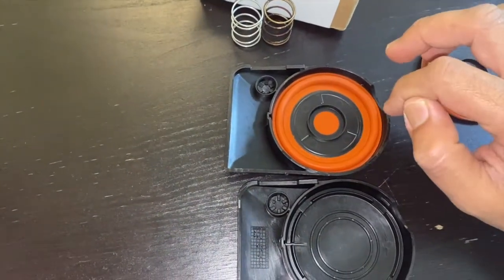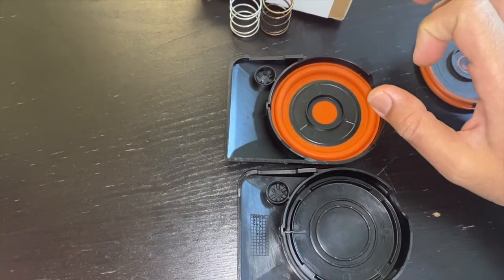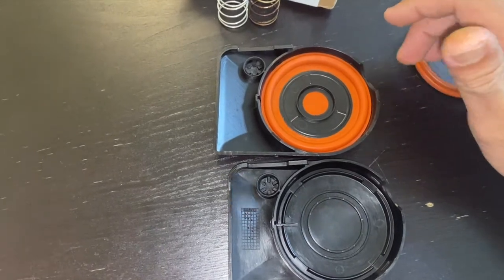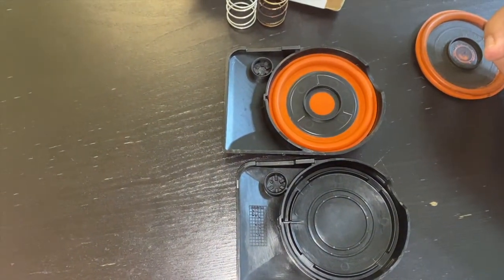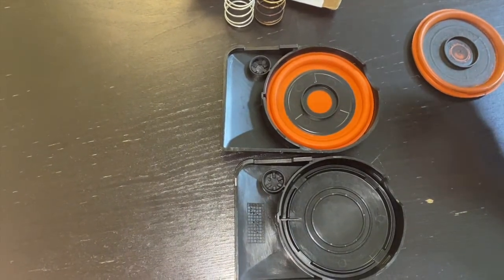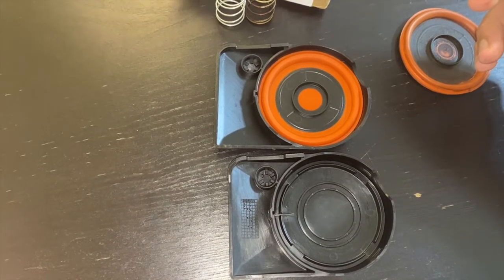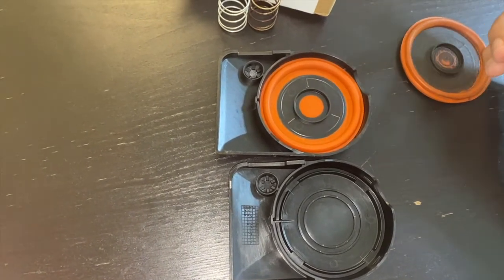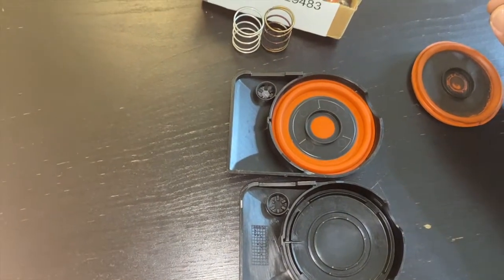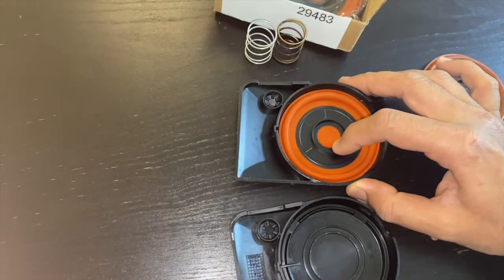My car was having an overheating problem whenever the RPM goes high — when I drive more than around 80 to 100 km/h, or when I drive continuously, the temperature stays at 120 to 130 degrees and it gives a high temperature warning saying drive moderately. That's the reason I'm changing the PCV valve.